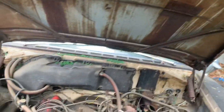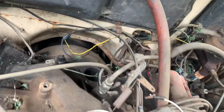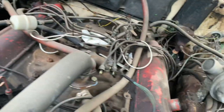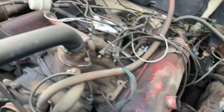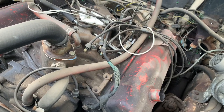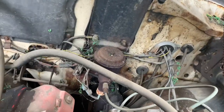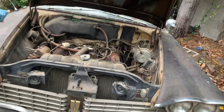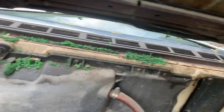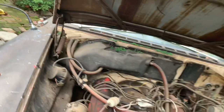I'm going to try to pop the hood. This is how I got it — it's missing the carburetor, which is a two-barrel carburetor. This is a 318 poly. The distributor's missing too. There's the fuel pump right there — so the fuel pump in the back may be a replacement one, or maybe from a different car. They also had an early Barracuda as well. This car has power steering, and there are the brakes — it's still got the single master cylinder. There's also some green stuff — mold? No, that's just dirt. No, that's green stuff. That means it's a green car, just like a Tesla. Very green, good for the environment.